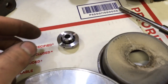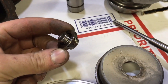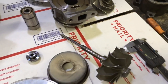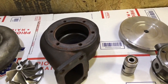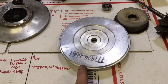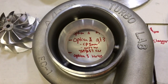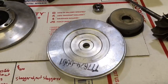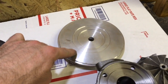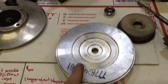You also need the thrust collar that's specifically designed for the GT37R in order to make this cartridge. After you have all these pieces, in order to make this work you will need a different compressor housing. The style of compressor housing that would fit with this is the same as our GTX3582R compressor housing. Technically you could use our GTX3582R compressor wheel if you use the two millimeter super backplate. If you want to use the T67 compressor wheel and not machine it, you need the five millimeter super backplate.